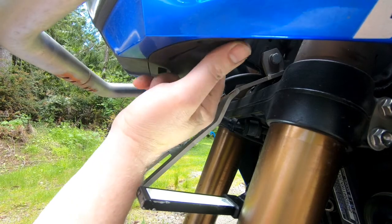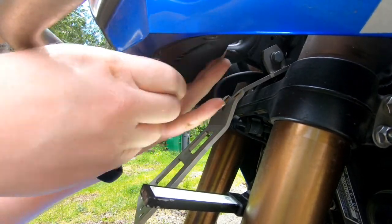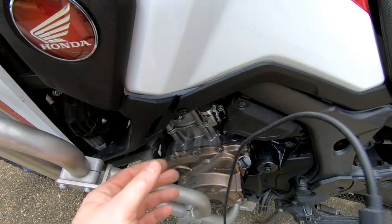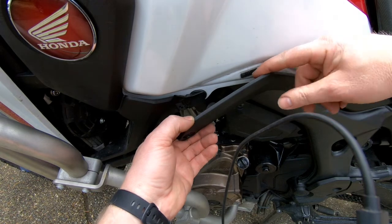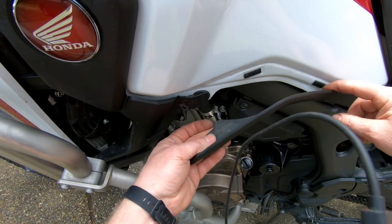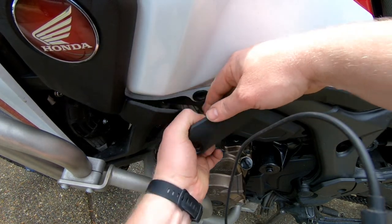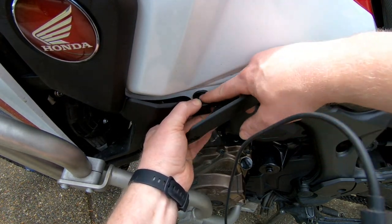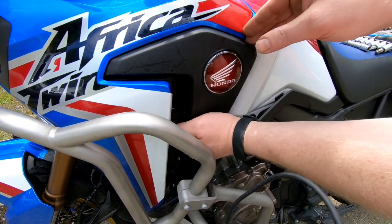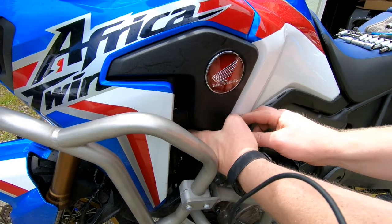Grabbing on the back side of that cover, you're going to want to pull down — it's going to be latched on the front and one little tab on each side. Now on the lower part of your fairing you'll see this little trim piece held on by some velcro — there are two pieces of velcro snap-on and a rubber grommet — so you're going to want to pull that out and then right around the emblem, grab around that and pop it on out.